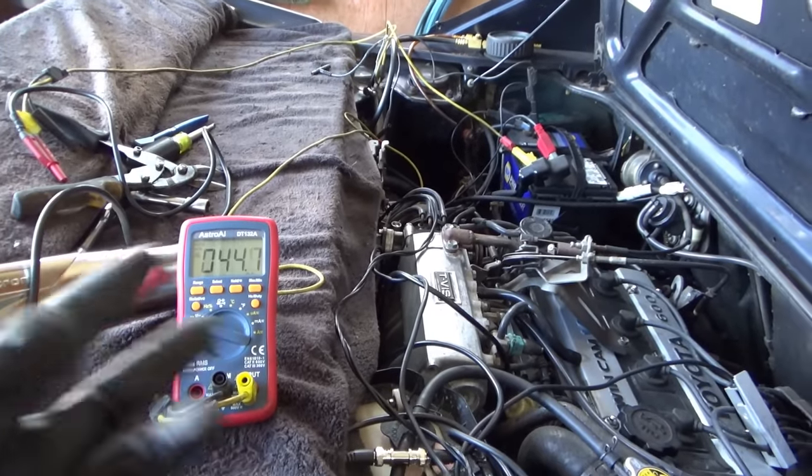Bonus footage - we'll do the cruise control. Let's shut it off and restart it. Unbelievable. Let's put on that jumper, do ignition timing and idle speed. With the jumper installed, the check engine light is just blinking once - good, no code stored. Looking at ignition timing, we're at about 5 degrees before top dead center. So we can bump that up to 10. Let me do that real quick. Then we'll adjust the idle speed to 800 RPM and we're done.